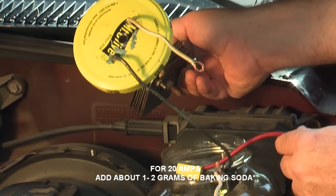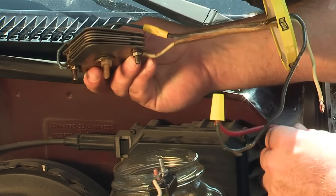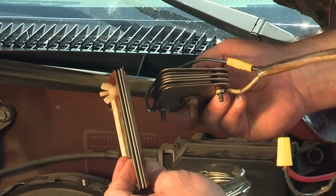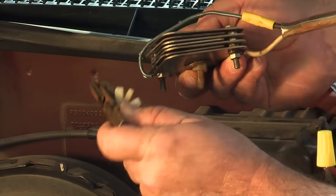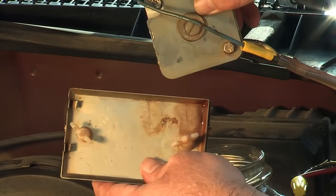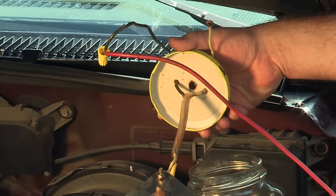Now, this is a very fancy cell element design. Don't be disillusioned by how fancy this looks, because very simply you can get three faceplates of high grade stainless, some Teflon nuts and bolts, and for about five bucks you can make this. I've notched it for the wires — put the positive in the middle, put the negatives on the outside, and boom, you've got it. I've just made a more advanced version.